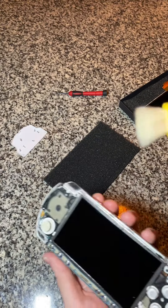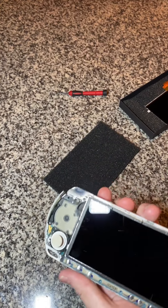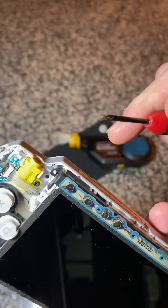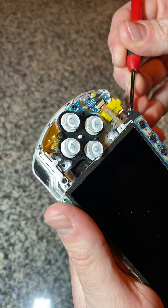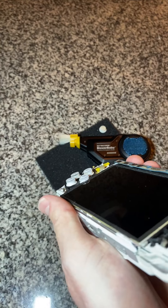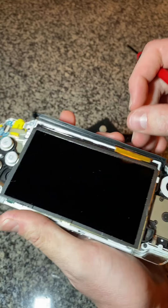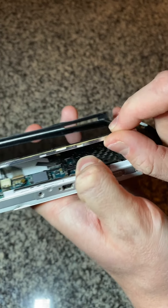I'm going to remove the screws so they don't get lost. Moving the screen and screwdriver aside, here's the main unit — let's give it a little dusting. There is a little latch right here, and you're going to pry it off its hinges easily. After you get it hinged off, it should slowly come off on the other side. You'll see there's a ribbon cable — just leave it there. The next step will be to get this screen off: pry it from this side and it'll come off the unit.